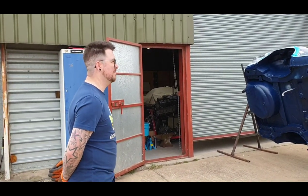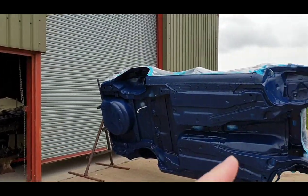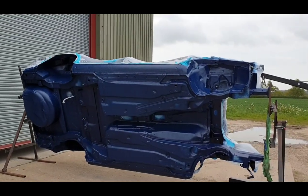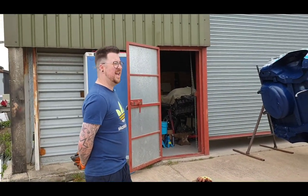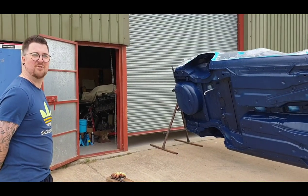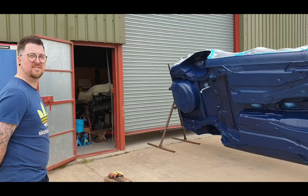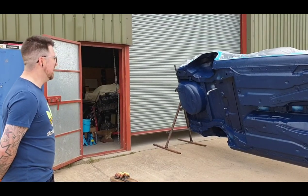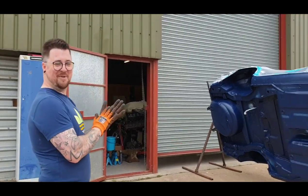Yeah, because from factory they did the same, didn't they? So from factory, what we've basically masked off are the points where the rear beam mounts, subframe mounts, etc. They'd actually marked it off and then undersealed around them from factory, didn't they, Tom? Yeah, when you removed it and we tidied and cleaned it up, they were surprisingly really fresh, weren't they? Solid metal, no scabs, no surface rot. You'd expect water to sit between the two pieces of metal, but they were really clean. Bravo, Audi. This is what you get, German engineering.